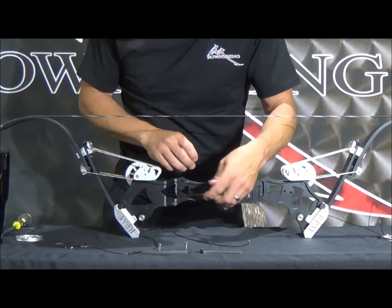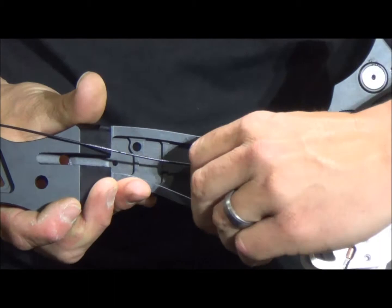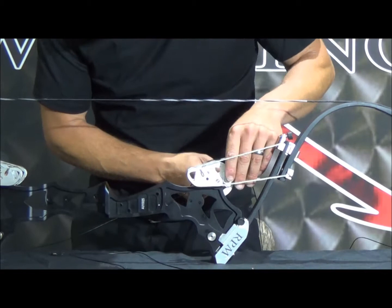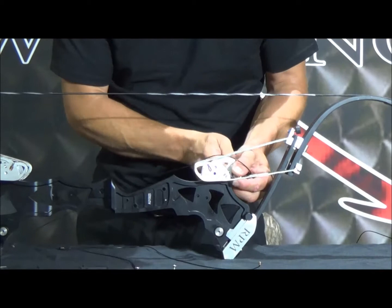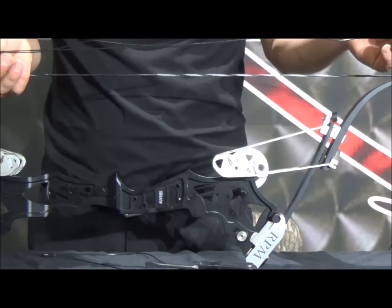We're just going to back them down through the riser itself. Take this through the face of the riser like this, and then go down through the center of the riser. We still have the grip guide down here, and the first crimp is kind of tough to get through there because of the tolerances, but just wiggle it through there. Once you've got that out, the second one will come through no problem. Then, same as we did on the Gen 1 Nitro, we're going to force the tensioner out — using something blunt, like the 5/16ths Allen wrench that comes in your kit — and force that tensioner out of the timing wheel and that crimp. If the timing cable is junk, you can just cut it and pull it back out. That's the split timing cable system.